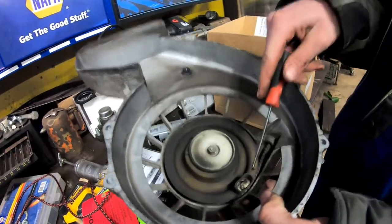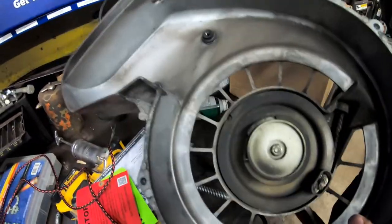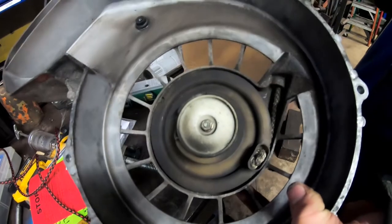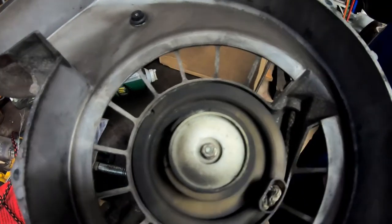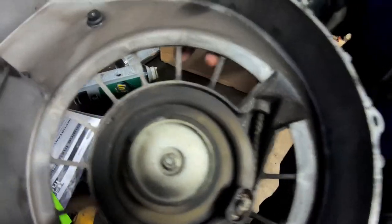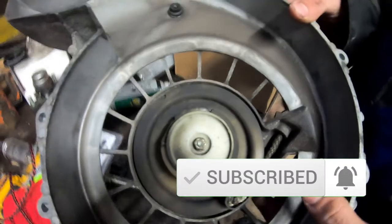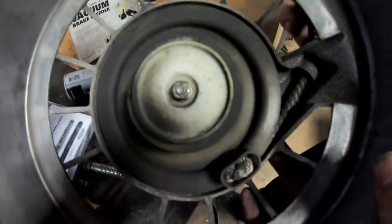The Indy recoils are very similar to this. This is how the inside looks. It's always easier to replace the rope before it breaks, because otherwise you have to rewind the tension. A general rule of thumb is you don't want to put too much tension on it, because you don't want to bottom out the spring — that's how you snap those little high-tension springs underneath there. You can rewrap those springs and put new ones in, but it's a lot more work. I have done it a few times; it's just not a fun job.